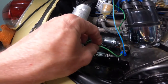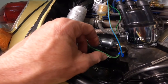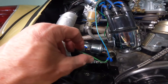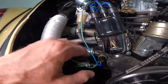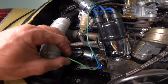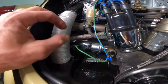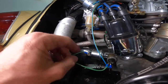This wire here is the green wire connection that goes to your brand new gauge. I jumped it from here to here, and there is a reason for that. Initially I thought about running an individual wire for this signal, however I already have a wire running all the way from the back to the front compartment that connects at the speedometer. Basically, I jumped a wire from here to here — it's the same thing. You can save yourself some time and receive the same signal through the OEM wire.